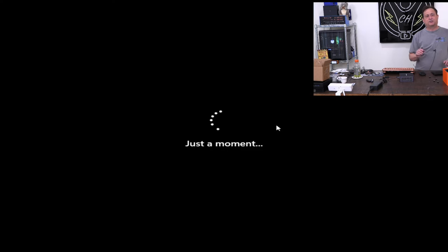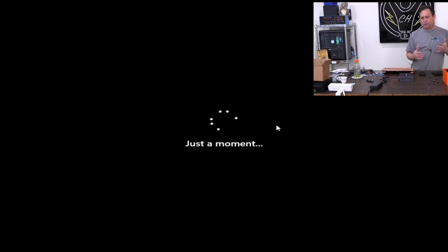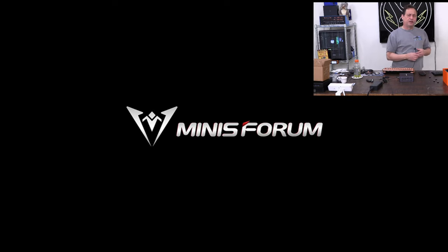That's adding an entry to our registry and restarting the computer. It's kind of a weird way Microsoft has implemented this, but it's essentially just making a change to the registry and causing a reboot. So then when we go through the Windows setup again, we'll have the option to bypass the network requirement for Windows setup. And so we're going to start that again, where it's going to ask our language, region, etc.